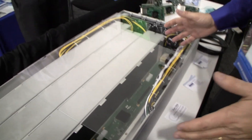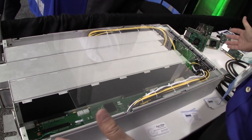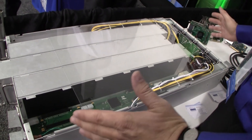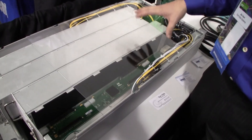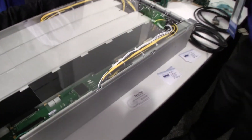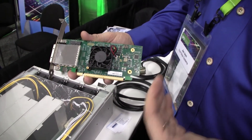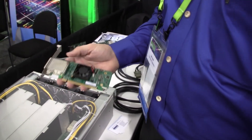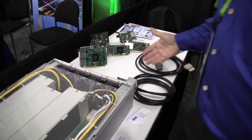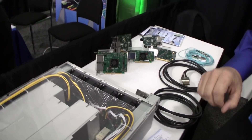What are we talking about? What we have is 16 GPUs in a single 3U enclosure that can go into any server rack that can handle 36-inch deep cards or chassis. It connects to any server, any manufacturer that has PCIe x16 slots. We use a Gen3 small host interface board that goes from any short card, short height system, and just about every server can handle that. That handles one to four rows of GPUs.